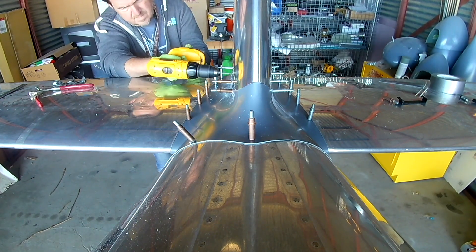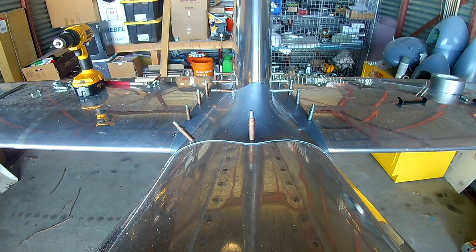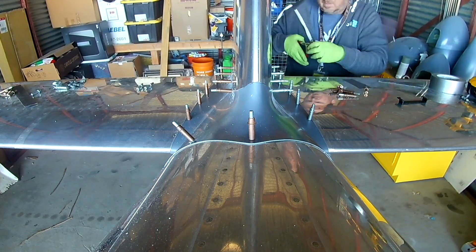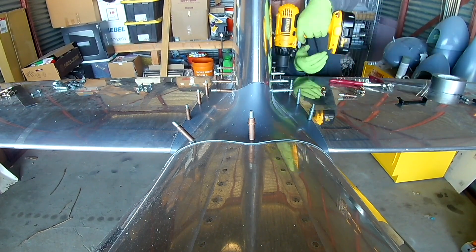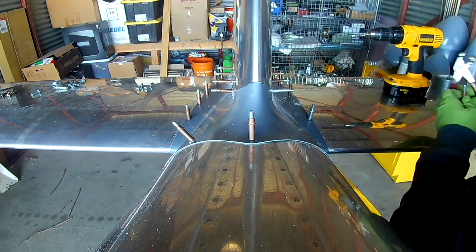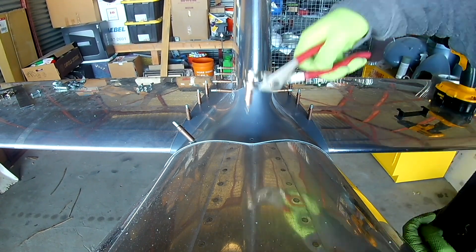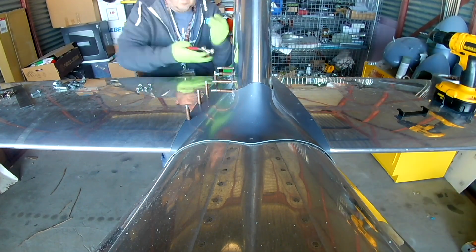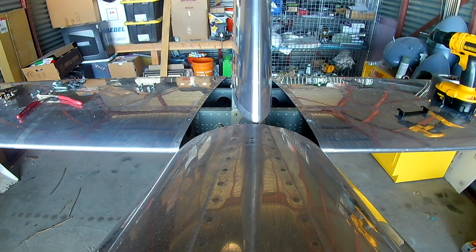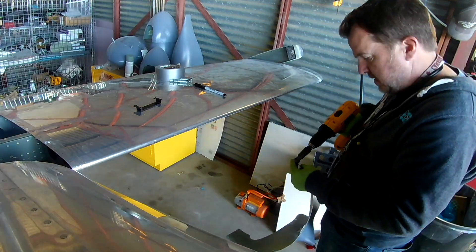Picking up from yesterday — all the holes have been drilled into the empennage fairing. Now we are upsizing those to number 27s for number six screws. Once those are drilled, it's just a matter of countersinking them for the heads of the number six countersunk screws, then going down the horizontal and vertical stabilizer as well as the tail cone, installing all the nut plates and being done with all of that.